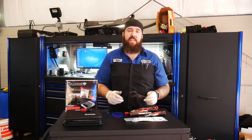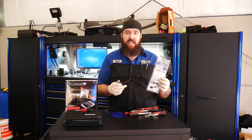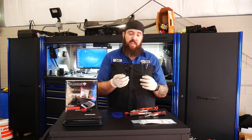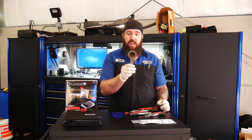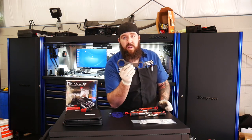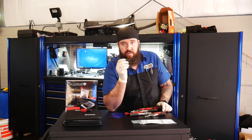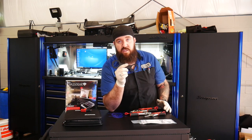The next tool on our list is a little specialty tool I picked up off the Matco truck. This is the Matco MST-1310, listed as a Duramax water and fuel sensor wrench. It actually fits pretty much anything — the 12-point end fits the Duramax side, and a lot of the Ford and Dodge ones, especially Dodge, use the six-point end. I picked this one up on sale for about $34.99. It makes my job working on these diesels and fuel filters quite a bit easier.